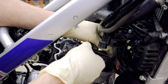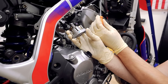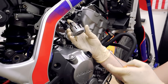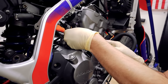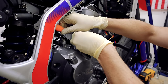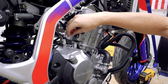Now we need to deal with the cam chain tensioner. We can't just stick this back in as-is, because this little plunger hits a big plastic guide inside and pushes it up to take the slack out of the cam chain. Over time the chain gets longer and the tensioner can't retract, so if we bolted it in under tension we'd probably break the chain. What you have to do is screw the plunger in while putting the tensioner back in to take all the tension off it. With the exhaust off and the clutch cable out of the way it's easier to get in there. Snug it down, then back the center bolt out so the tensioner releases and puts the chain under proper tension.